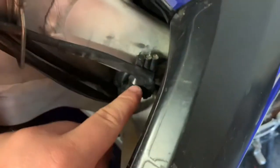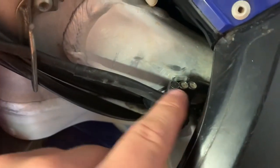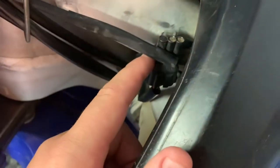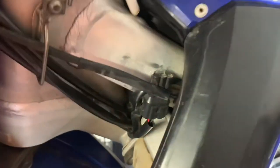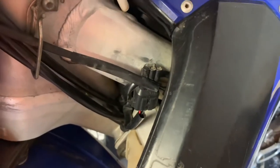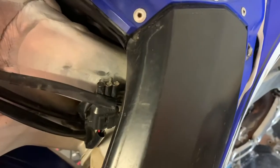When you run it under the number plate, it comes around and pops right into the top. There's a little rubber gasket, and you pop out on the left and right side — one side is positive, one side is negative. Then you have these little brackets that you solder onto the wire — they basically slide down in there and are only about six dollars on eBay.